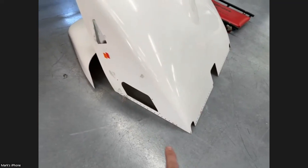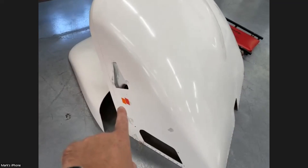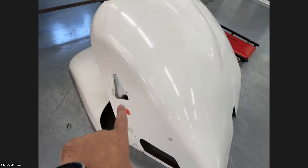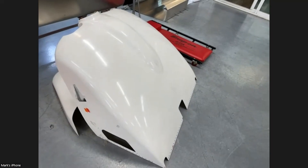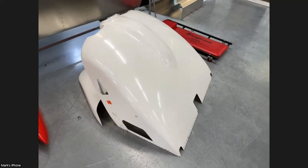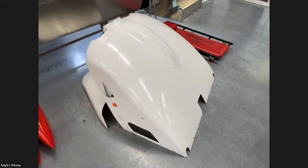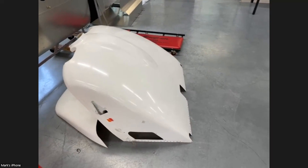There you can see the right-hand side radiator exit. We have a small NACA inlet for intake air with the gear legs here. We really wanted to keep it tight and streamlined and retain that legendary performance we're known for with this airplane and this engine installation. The Rotax doesn't need any baffles in the installation, so that saves a little bit of time.